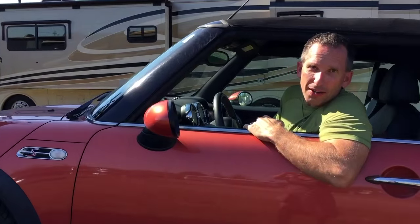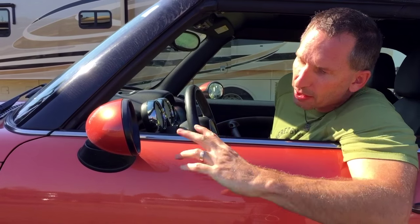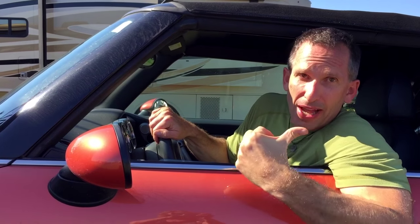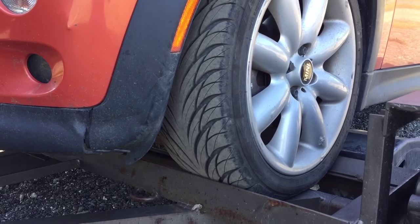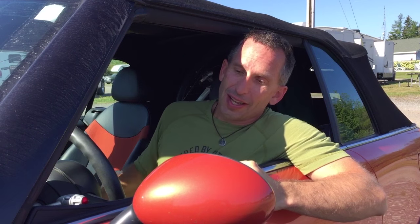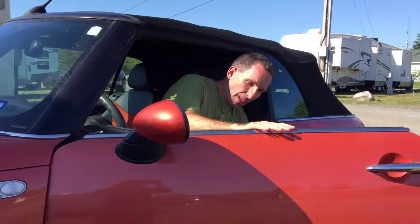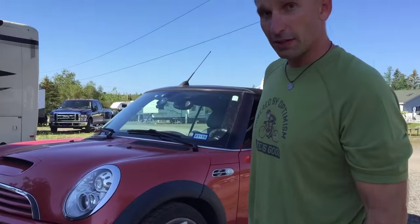You can tell it's not all the way against the rail. You'll also notice that sometimes the dolly moves underneath the pressure of the car. One trick that I've learned is I pull the emergency brake up so the back tires aren't moving, and then I let the engine pull forward a little bit. I definitely want the tires right up against the rail, which I think I've achieved now. So I'll be able to turn off the vehicle, leaving the emergency brake on, and then I'll double check.